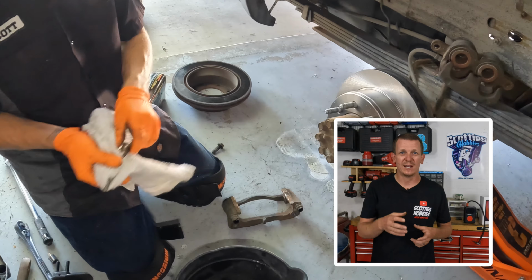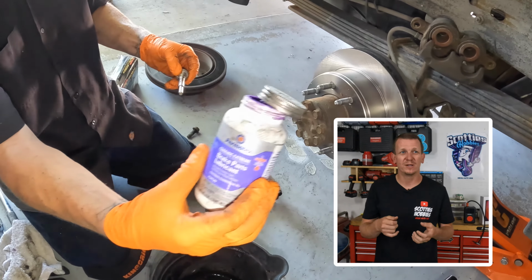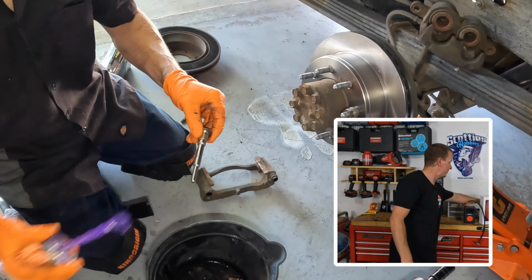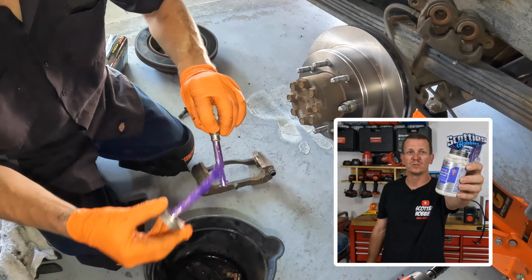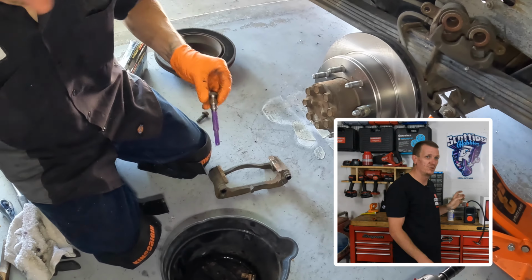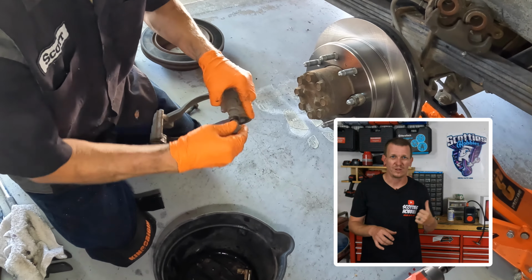After you get the brake caliper slider pin holes cleaned out, we're gonna clean off the slider pins themselves and lube them up. I use some silicone, it's not silicone, this is some ceramic grease. This is the new stuff I've been using. I really, really like this stuff. A little lube goes a long way. You don't need to slap too much on there. It works really, really good. There will be links in the description for that as well.